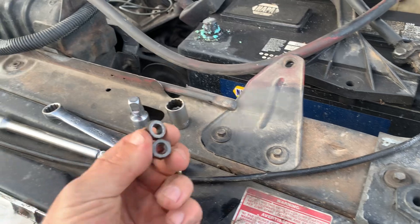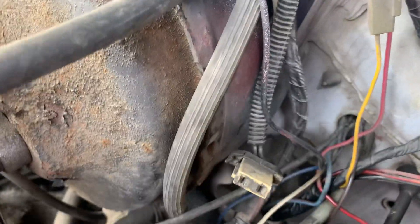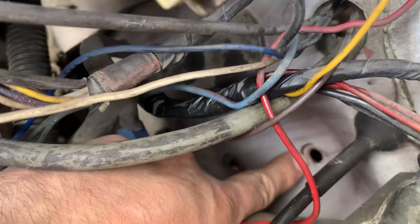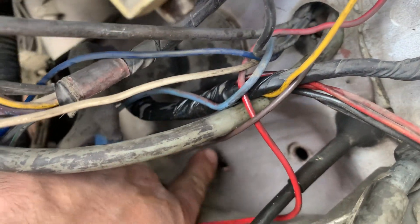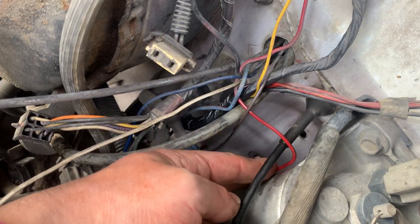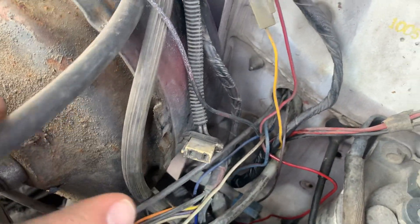These two nuts come off the parking brake bracket. There are two studs that come through. There's a fuel water separator right here — see my finger? There's a hole right there and a hole down there. There'll be two studs with those nuts coming out right next to this water separator, to the driver's left or the viewer's right of this brake booster.